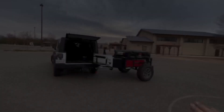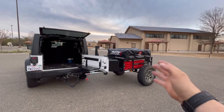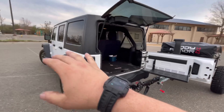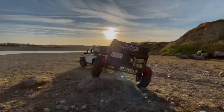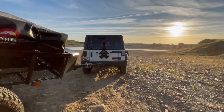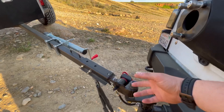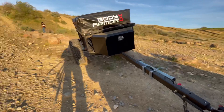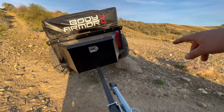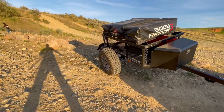Now it's time to take it off-road. Let's go ahead and see what this thing can do. I think I like the trailer and camper on this side — that way I can still get into the driver's side door and still have access to the back of the Jeep. Here you can really see the benefit of having this Max Coupler articulation hitch. You can see the degree of twist — what we call articulation — on the main tongue of the trailer. When I made this turn, it had to take it a little sharp, and it caused the rear wheel to basically climb up this rock. There's definitely going to be a new set of challenges when off-roading with the trailer, but here's an example of those challenges and what the articulation hitch offers.